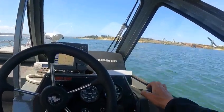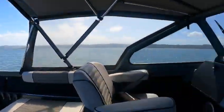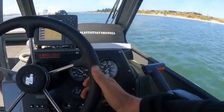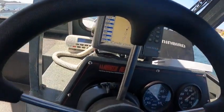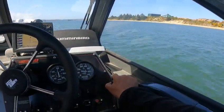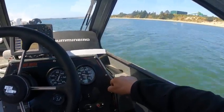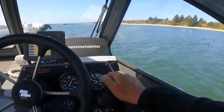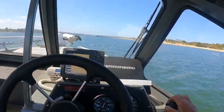Now right here I'm going to trim it up. Good — no water coming up. Right height right there is a good cruising speed, about 40. About 4800 RPM, and you're doing about 30-32 miles an hour. Open her up, trim it up so it's perfectly pitched. I could just max out the trim — I can hear the rev limiter — so I'm going to kick it back. Right there, that's about 44 miles an hour, but I'll guarantee 40.